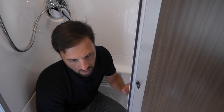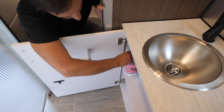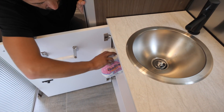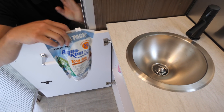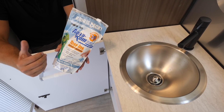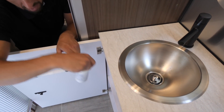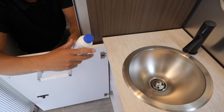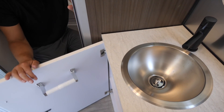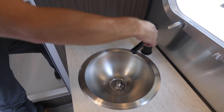Colonial Airstream gives you some toilet paper to get started — make sure it's septic tank safe, RV/marine safe. These are drop-in tank deodorizer pods: flush one pod down the toilet per 18 gallons of waste after you empty the black tank. Airstream also gives you a liquid form of that — follow the instructions carefully, as it is corrosive.